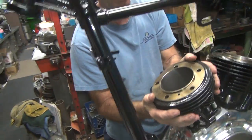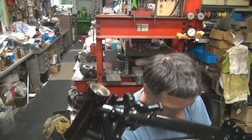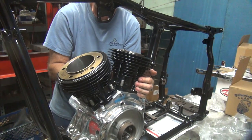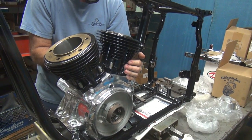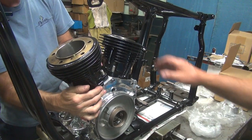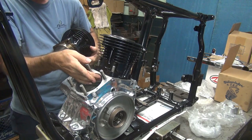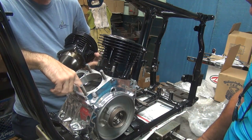Okay. You going to show them how bad these cylinders are on here? In a second here. Look how loose that one is. Sorry about that, camera folks. Look how loose this one is. This is too loose of a bore inside your case. So you've got front and back, side to side. That's pretty loose. This one here is loose this way, but it's tight this way, probably because the stud is taking the gap up. Yeah, that's the stud hanging in there. And watch out because they didn't burr the inside.